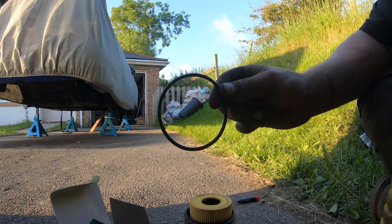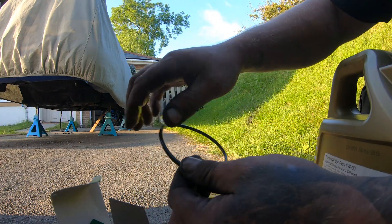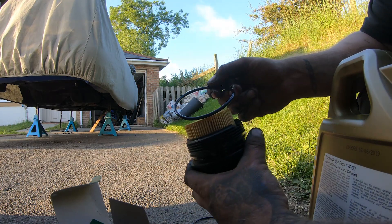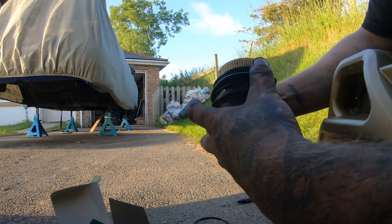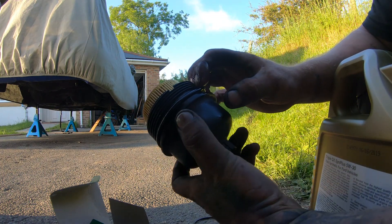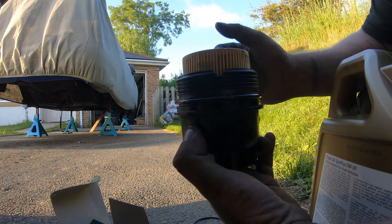There's the o-ring — you want to put a little bit of oil on this. Just a little bit and spread it around like that. When you put it back in the van it won't pinch. Feed it back on into that groove all the way around, and that's it. Make sure it's not twisted or anything — this looks all good and is ready to go back in now.